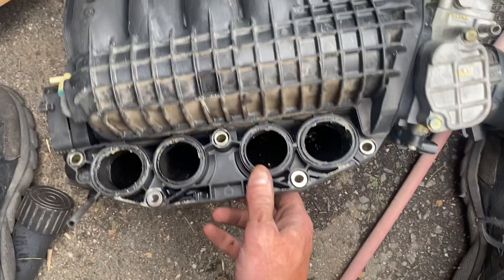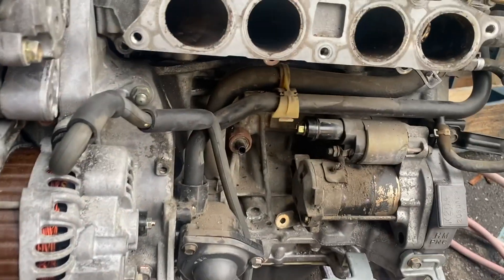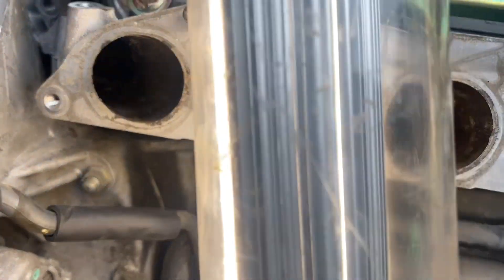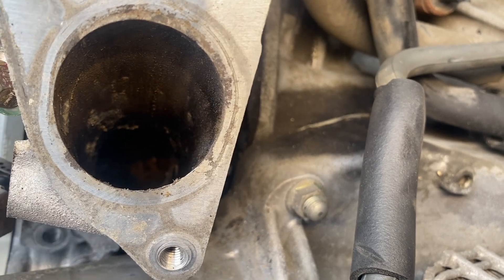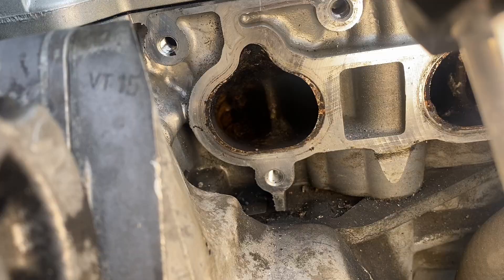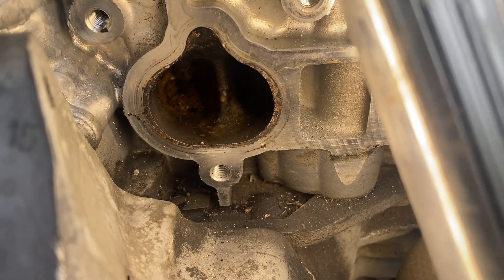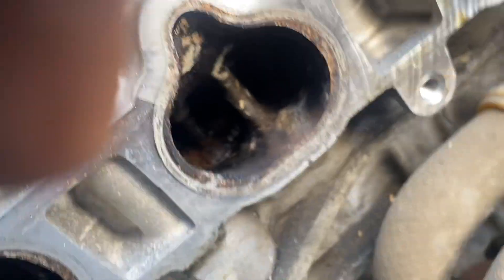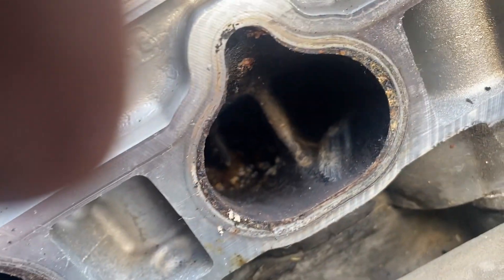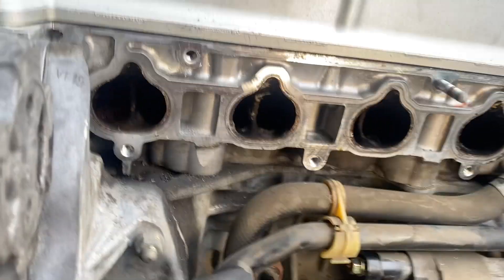I should have recorded before I poured it out — there was about a cup of water inside there. Turns out there's a solution they dunk these engines in, which is why it looks so clean, but there was a lot of sludge. You can see right in that one cylinder there's some white stuff. I'll take a vacuum and duct-tape a straw on it to vacuum all that out, because I definitely don't want to start it with that in there. Cylinder four is the worst — the other three aren't so bad.